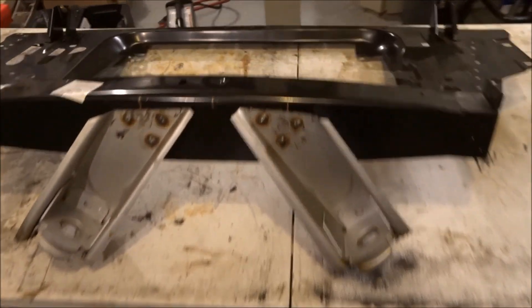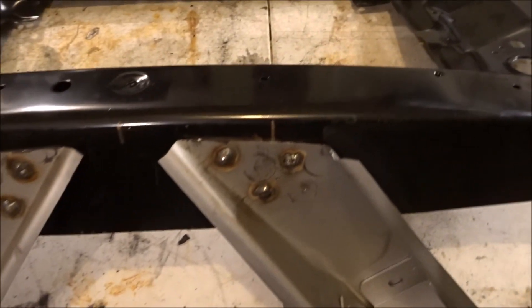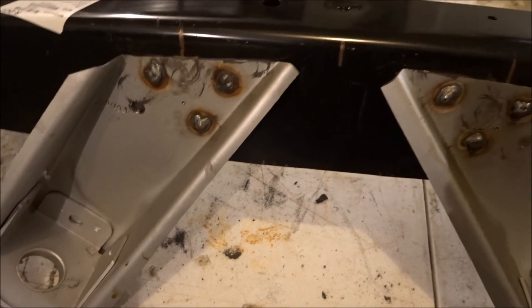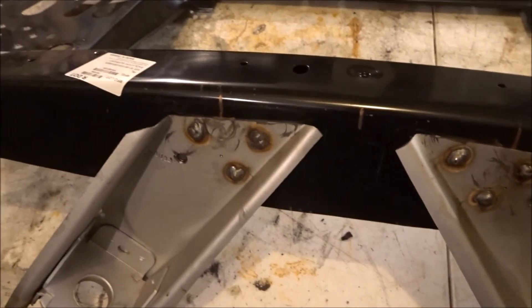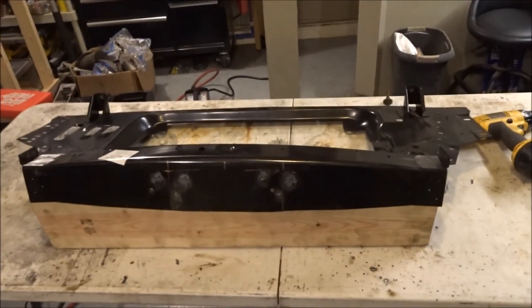Moving on to the core support — it's still a pretty decent piece of metal and I should be able to reuse it. I just have to get these guys off the bottom without gouging into the good metal of the core support. I'm using gouging at this angle so I don't accidentally pierce into the metal I want to keep — looks like just three welds on each one. There you have it — they came off really easy, about two minutes per bracket. You can see just a little bit of slag left, but didn't gouge into the parent metal at all.